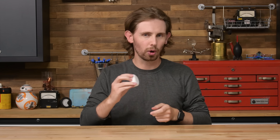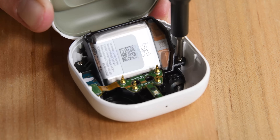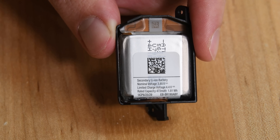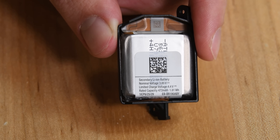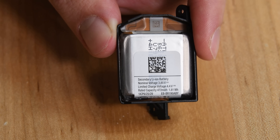Let's do a speedrun through the case, which hopefully is just as good as all the other Galaxy Buds cases. An opening pick and a spudger to pry up the Buds bed, loosen a few screws, and — whoa — the battery comes right out. That's even better than previous cases. From here, you could unstick the 1.8 watt hour cell from its well, or replace them together.